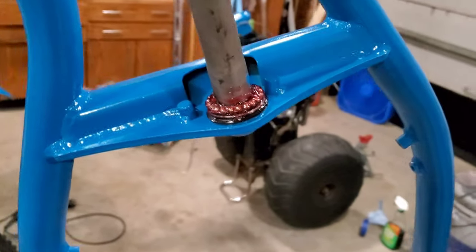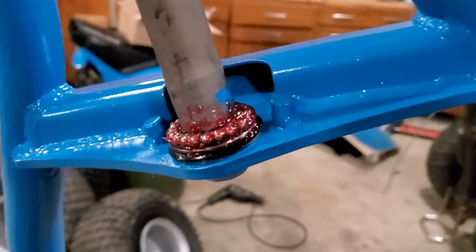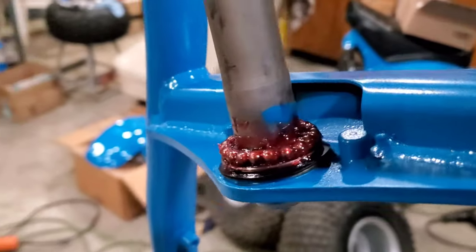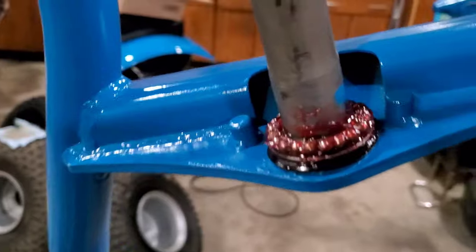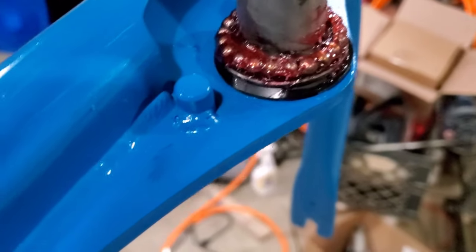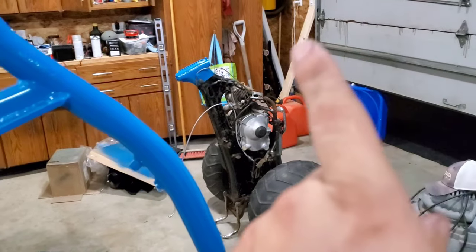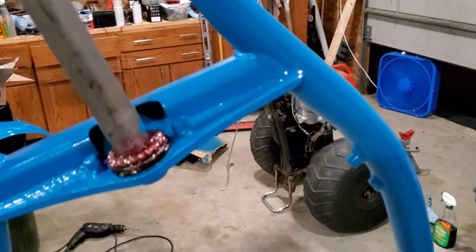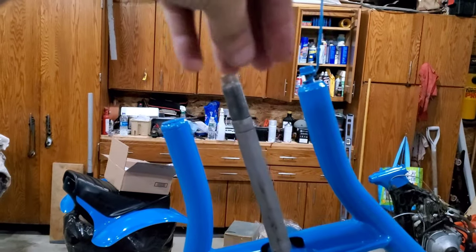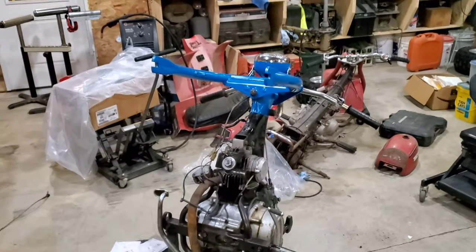Okay, so that dust seal is on. All the bearings are present and accounted for. Hey, if you're ever doing this and you don't have a continuous strand of bearings all the way around, you've dropped one. They don't leave gaps. They're all shoulder to shoulder in there. So this is a really sticky grease that I'm using for this. So when I switch over and slide this in to the neck, hopefully everything stays where it needs to. And then I can screw the cap in on top and be in good shape. Let's try it out.